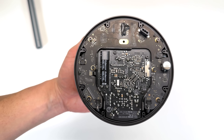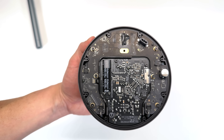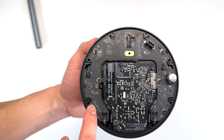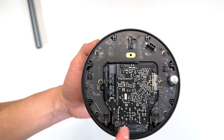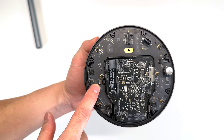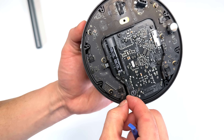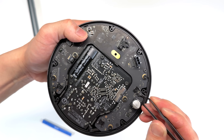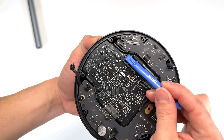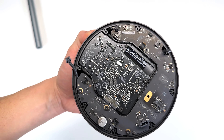Here is a look at the base of the HomePod. There's some thermal paste here that was adhering this component to the heat sink. There are six more T6 Torx screws to remove to gain access underneath. I want to note that there are four plugs here, likely for the four far-field microphones, as well as one connector here. I'm also going to remove four TR6 Torx screws as well as another Torx T3 screw here.